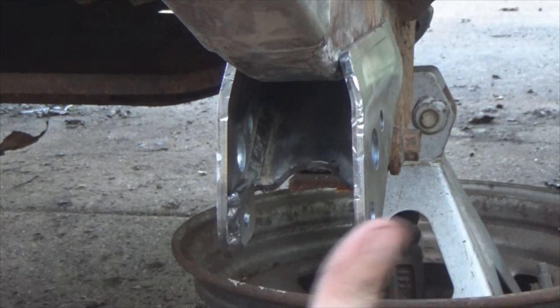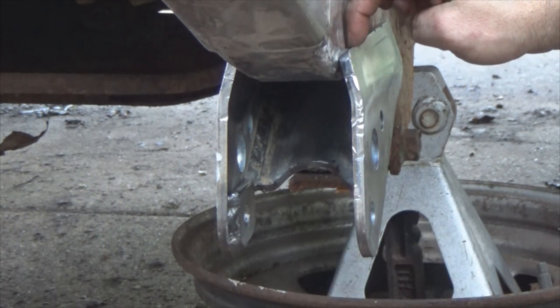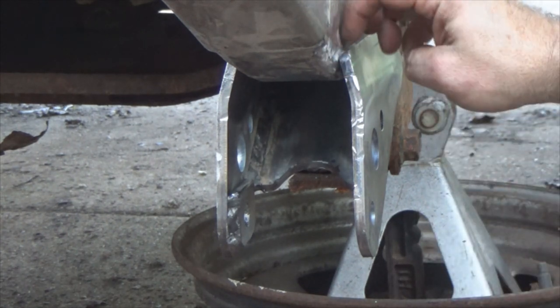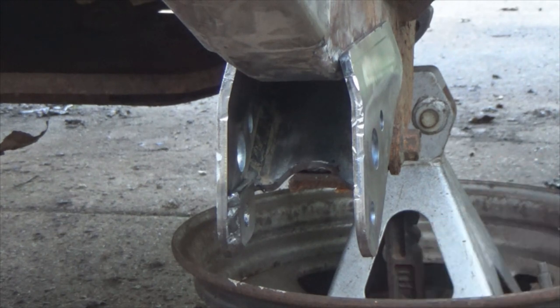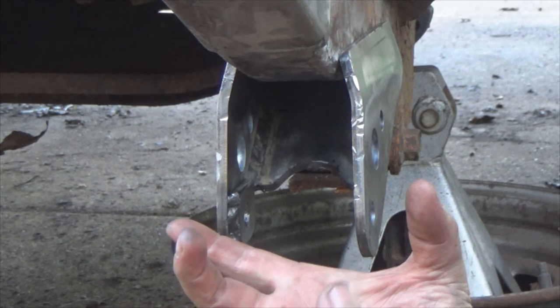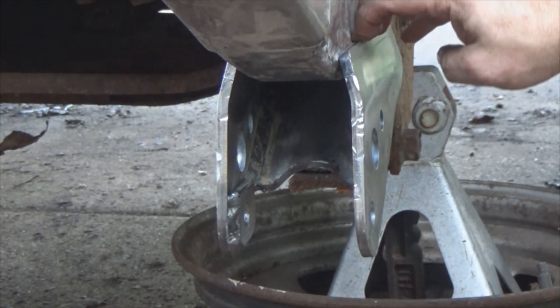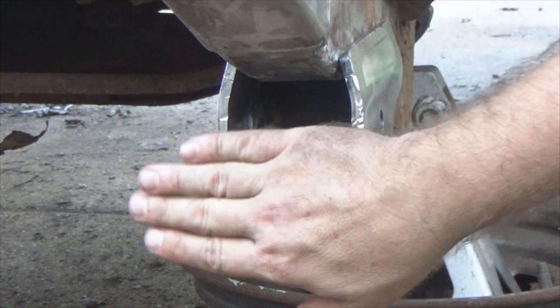While I did all the welding up on the side here, it drew up a little bit — kind of squeezed in just a little bit. So I had to take my grinder just inside that edge right there and knock off about thirty-seconds of an inch off each side right there to get it back up on there, because I was beating on it and it didn't want to move. Apparently my metal drew inward just a little bit by running those beads inside there.